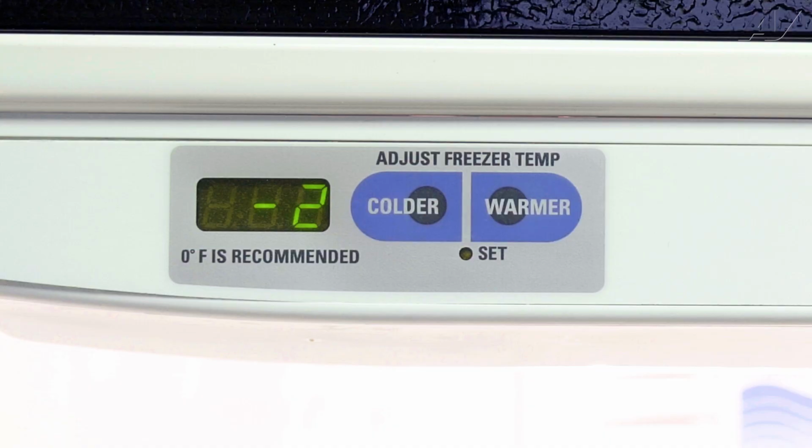Most ice makers need to have the freezer temperature at 15 degrees Fahrenheit or colder to go through the harvest cycle. If your freezer is not cold enough, the internal thermostat of the ice maker will not be satisfied, and it won't enter the harvest cycle. This could be an indication that there is something faulty with your freezer, causing it not to cool properly.